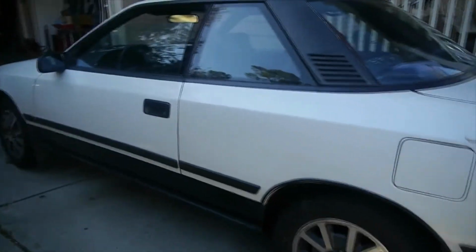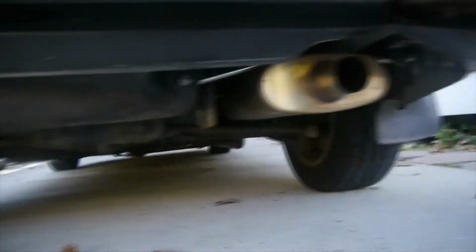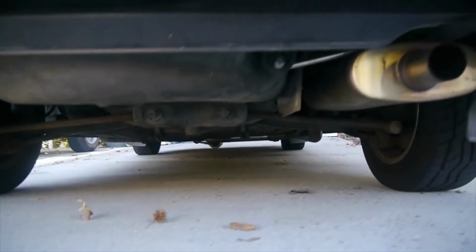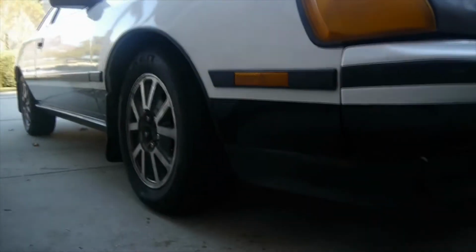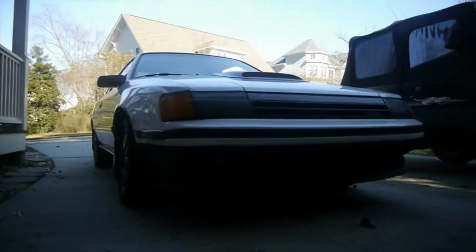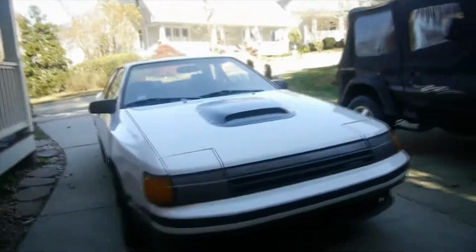The major upgrade that I've completed recently was swapping out the old 3S-GE for a 4th gen 3S-GTE turbo motor. Here's the 2-inch exhaust that I had made for the 3S-GE. The 2-inch is an improvement over stock, but it's still very undersized for the turbo motor. That was one thing that recently I've had to work around with a 2.5-inch cutout. But yeah, overall it's a great swap.